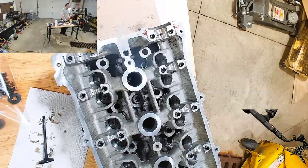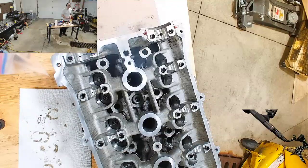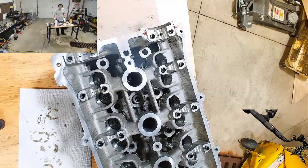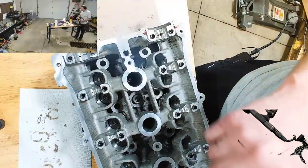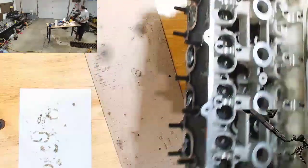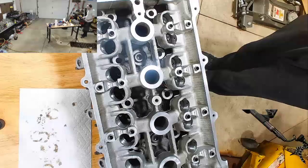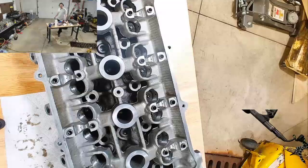And it's crazy — the only reason why we're taking the valves out right now is so I can properly port the head. It's going to be insane. One of the other things I plan on doing is de-shrouding the valves. That actually grinds in the combustion chamber itself, so it's making me wonder: can I effectively lower my compression ratio by grinding out a certain amount? Because a lower compression ratio on a turbo motor means you can make more power, and it's less prone to detonation.